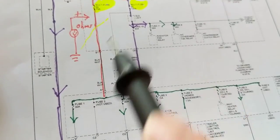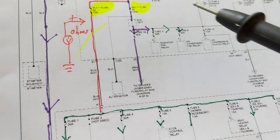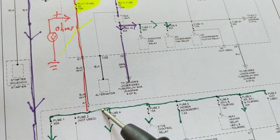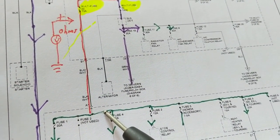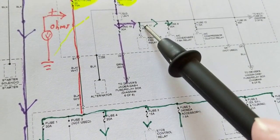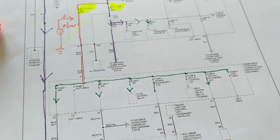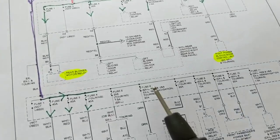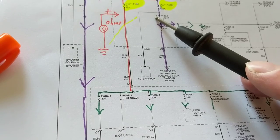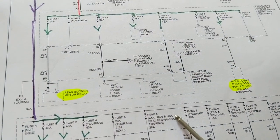That's why I say take out the schematic. Take out the schematic. You don't know if this is feeding a bunch of loads or one high circuit. If I look at this, I don't know if this is feeding 1 circuit or maybe 2 circuits. I don't know. That's why I take out the power distribution part of the schematic. And even if you put another fuse and you got lucky, it didn't blow, maybe next time it will blow. This is the safest way to do it.